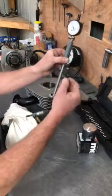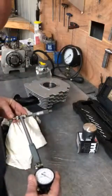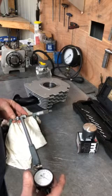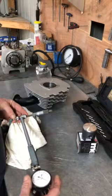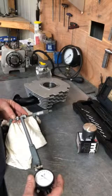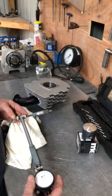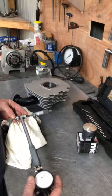This is the piston bore clearance instrument. We set this at zero — I like to hold it in the micrometer and rotate it around to make sure that we get zero. It's very important that this is zero. My dial is telling me that it's zero here, and the little scale is telling me that it's number four on the small scale.